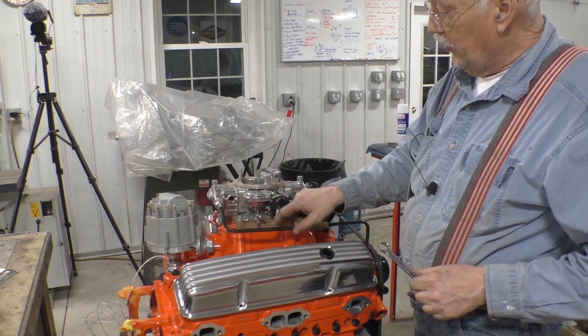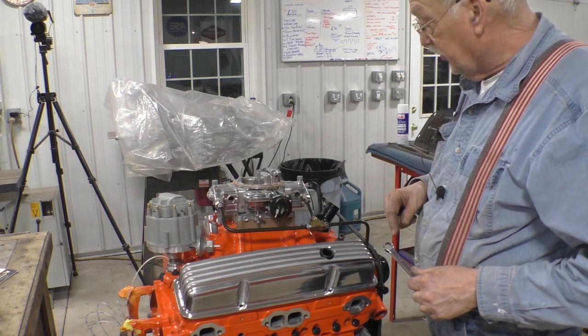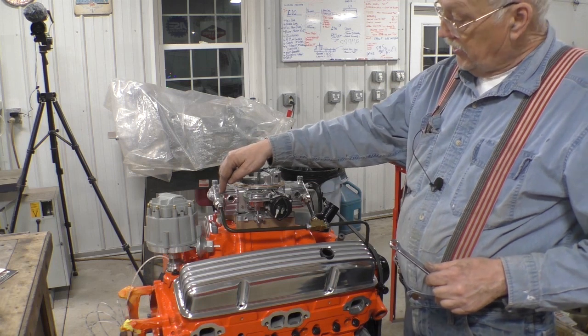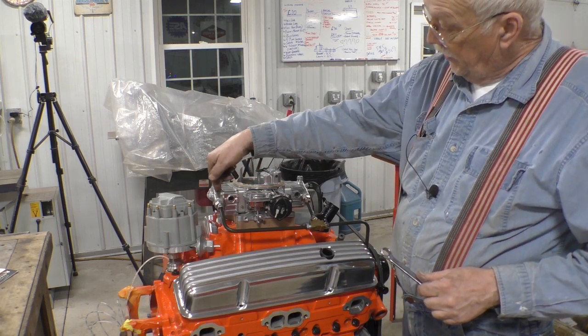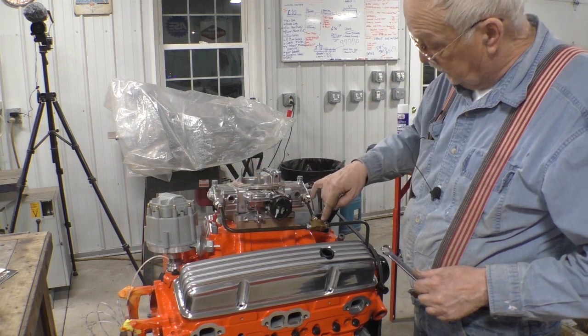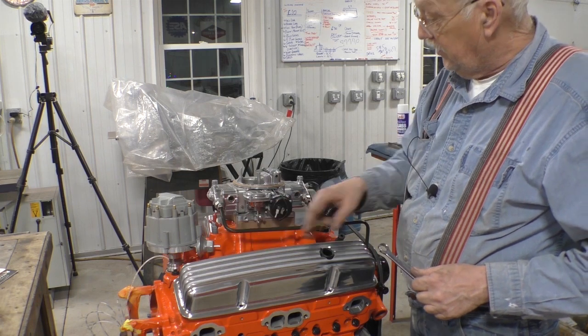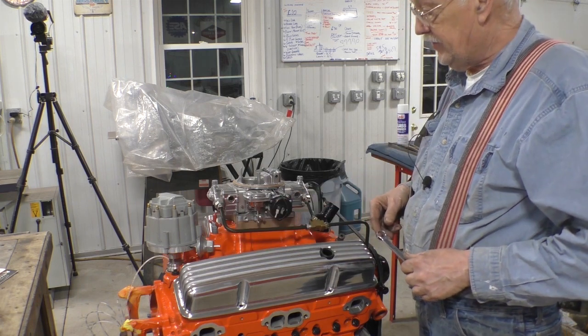This line should be relatively easy, but as soon as you say that, it's going to be the hardest one we've got to do. What I like to do is make a bend with a pipe that's too long. It's like from there, go down and across to here. And then I can trim to the right length and have my 90 real nice in the right location. So that's what we're gonna do.